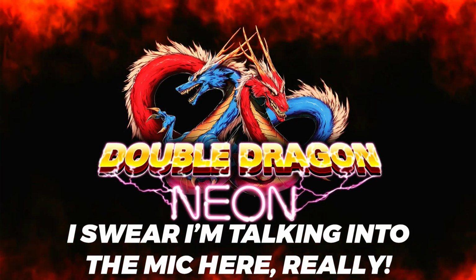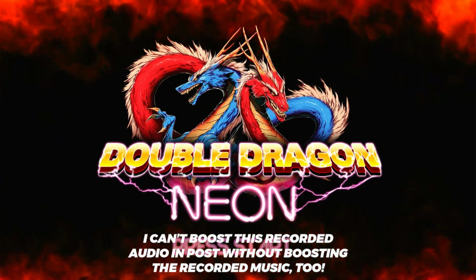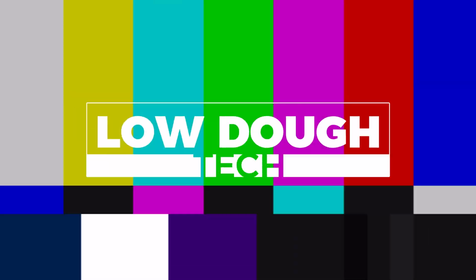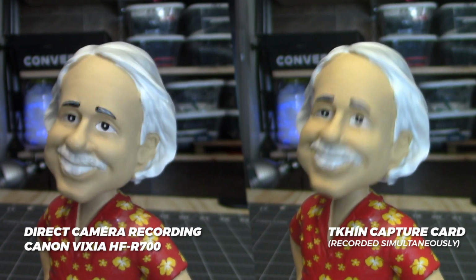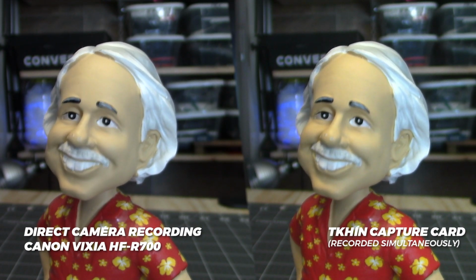And you're going to hear in the preceding clip that when coupled with an HDMI device with this analog audio, the input from this 3.5mm mic port just doesn't cut it. It gets drowned out. And this is what it sounds like when you place the microphone, the direct input of the HDMI. The HDMI overpowers the microphone tremendously. If you're looking to use this card to capture the output of your camera's HDMI port and turn it into a makeshift webcam, it will get the job done.